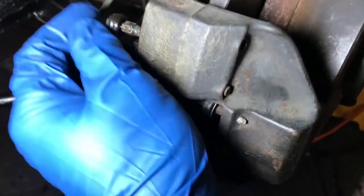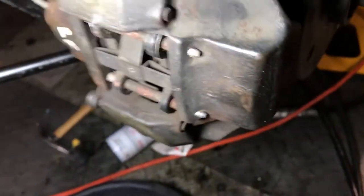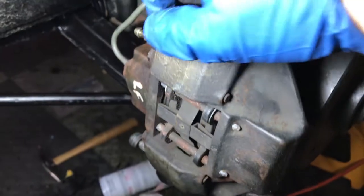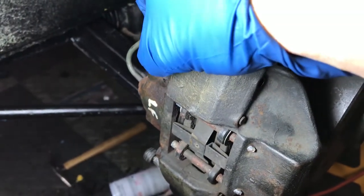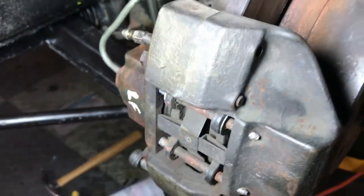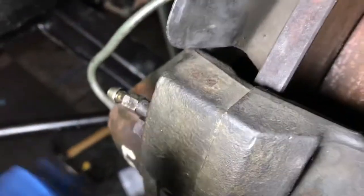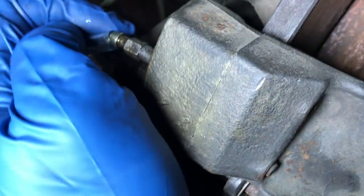Here's the front left caliper and this is the dust cap — we'll take that off. What we're going to need to do is loosen the bleed screw up here with a vice grip. I've pre-loosened it so it's kind of ready to go. And then we've got a length of PVC hose into a jar, old school Snapple style. What we're going to do is connect the tubing to the bleeder screw.